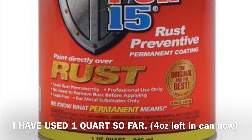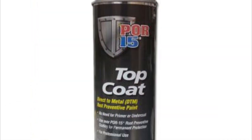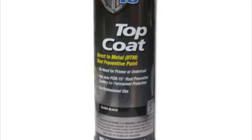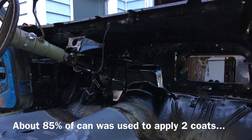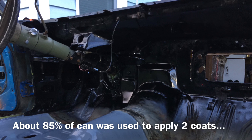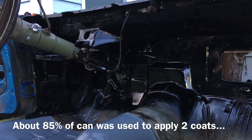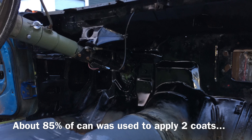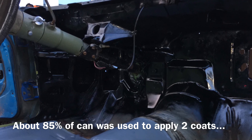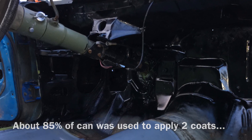As for the black paint you see — that's another product from POR-15, but it comes in an aerosol can. It was just easier for me to apply that to the front portion of the car. As you can see, there are a lot of different little pieces to the dash, side compartments, little holes and cavities, so it was just easier to spray inside there versus brushing it in.